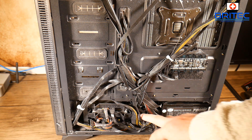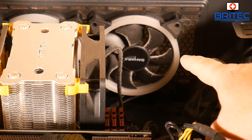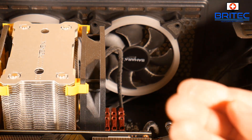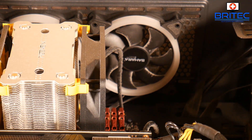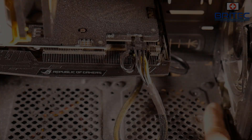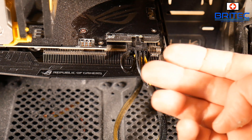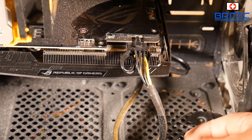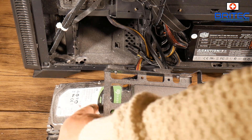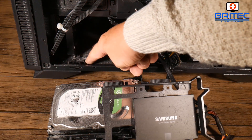If you've got a small case like this one, it's not going to be ideal because there's not much airflow with all the restrictions from the cables. When building PCs and keeping them on the ground, make sure you get good airflow for all the components. The dust is also picking up on all the fan fins, and if you're a smoker it will start to stick. Heat can't dissipate through dust — temperatures will rise, potentially causing hardware failure, crashing, and other issues. Even the hard drives haven't escaped it, with big clumps of dust all around them.